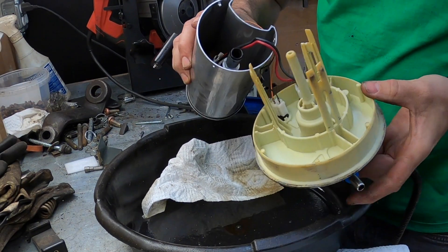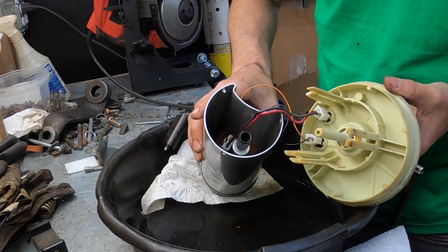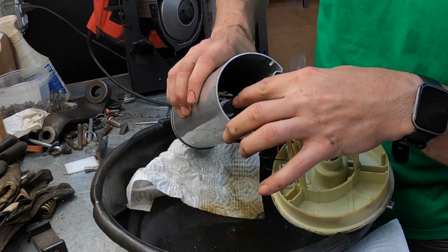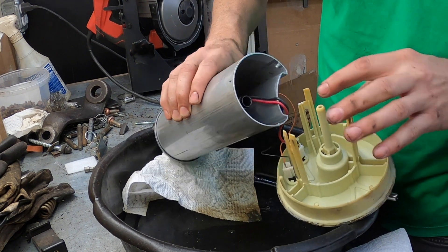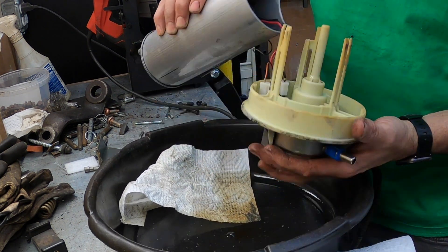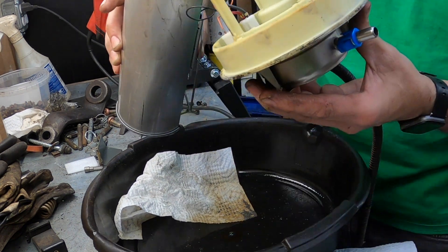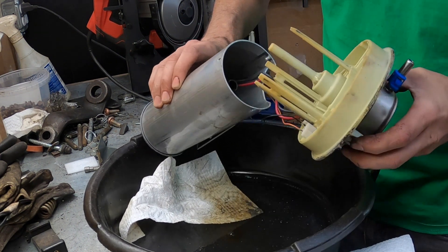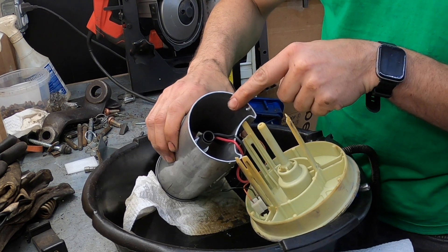As you can see, this separated — this is supposed to be together. This shaft here rides inside this orifice here. There's a seal right there and this is supposed to kind of seal against the shaft and ride up and down. In fact, there's supposed to be a spring here, which might still be in my gas tank, so I'm going to go fish that out. But what I'm going to do is try to remove the pump that's down there and pull that up.